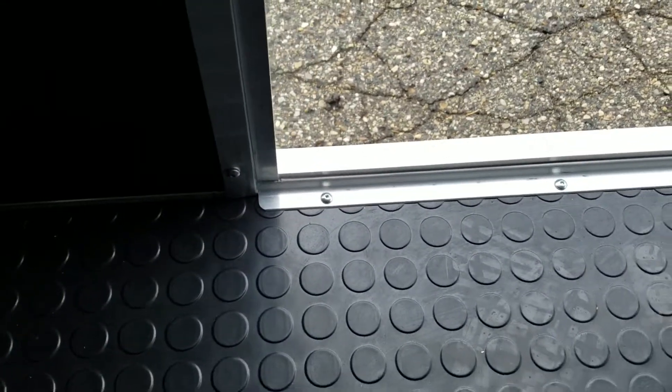On the inside we always use a 12-volt switch, and it's black to match the decor of the trailer. The trip door is trimmed out on the inside with angle — you can see the miter is nice and tight, no gaps. That's another thing we take pride in: quality build. When you spend the money you want something that looks nice but is also functional and built to last long term. We use cove on the step well — the corners are radiused, we don't just leave a rough square cut from the chop saw. These are the little details that separate us from competitors in this price bracket.